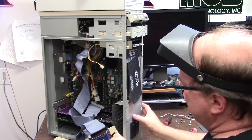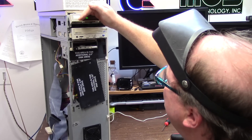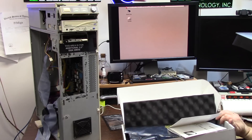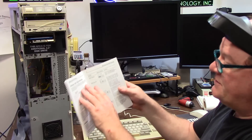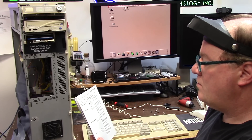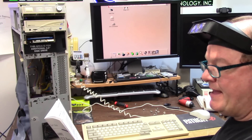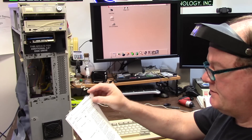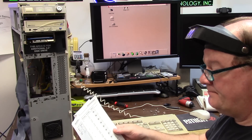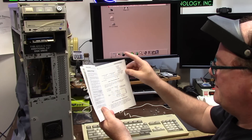Energize! Light comes on, hard drives are blinking. SCSI bus is blinking and checking itself. It booted. I'm going to put the support disk in. Here are the jumpers for SCSI addresses, IDs, and fast SCSI bus — if your device doesn't work on fast SCSI bus, use a shorter cable like the one in the box. Shorter long spin-up, synchronous mode — nice, it's on by default. External termination if you want to use that termination board. Logical unit enable and all the address settings for devices on the board.